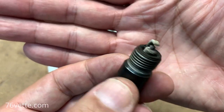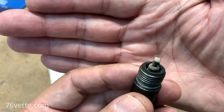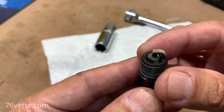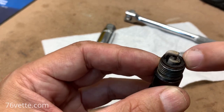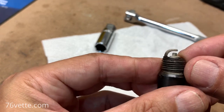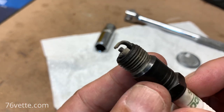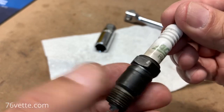I know I waited a little bit too long to replace them, but as you will find out if you do this, it's a pain in the butt. It is doable, and I think it's a good idea to replace the spark plugs every 10,000 miles from now on. This one looks pretty good — it seems a little melted on the ceramic portion, but I'm not an expert. The electrode looks pretty decent. No oil — it's actually in really nice condition, but ready to be replaced. This one has about 22,000 to 24,000 miles on it.